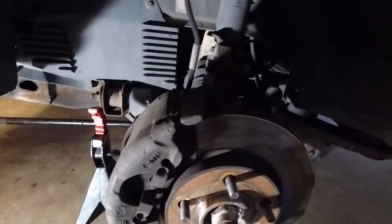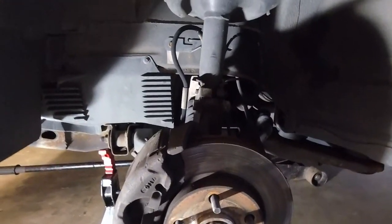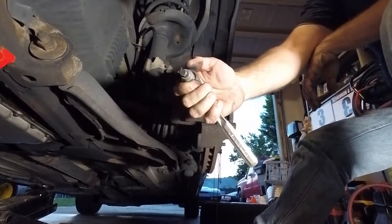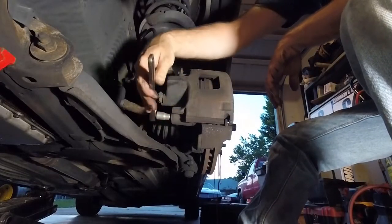So let's get some tools, figure out what I need, get the caliper off, get the rotor off, compress the piston, and we'll go from there. All right, so GM, a lot of the time in the 80s, used these Allen heads. So go ahead and...